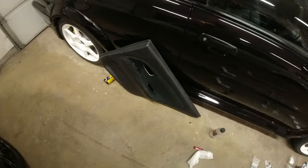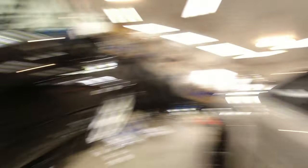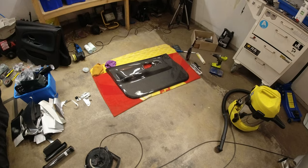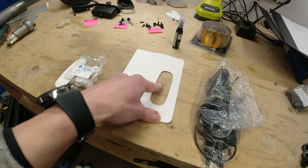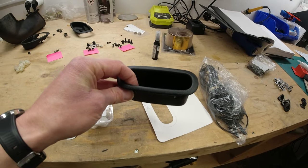The cunning part of the plan is the door handle. Here's the door card for the rear of the black car — this door pull fits perfectly with the front door card from Rallitech. That is in my opinion the best solution if you don't have electric windows and don't want switches. That just means making a nice hole for it to slot into. Now here's the passenger door card — we need to cut out for the handle and I've made a little template for that.